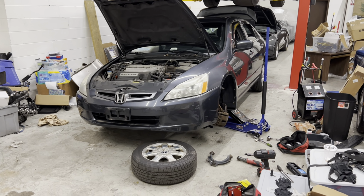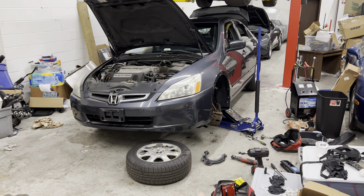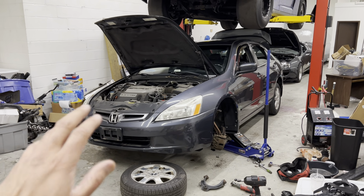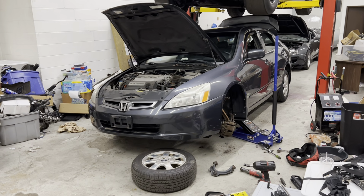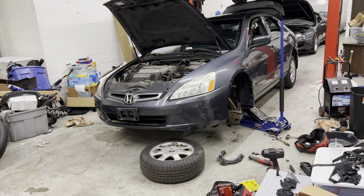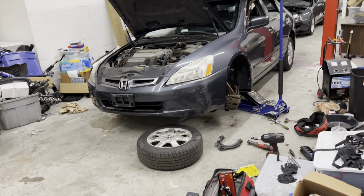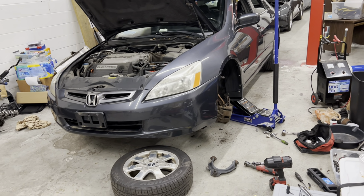How's it going, everyone? In this video, I'm going to be talking about how to check and replace your upper control arm on your mid to late 2000s Honda Accord or Acura TL or any similar type of Honda. These control arms commonly go bad. You should probably check them every month as a preventive maintenance thing because it's a safety issue. If you hear some clunking while driving or if they have any play, you should replace them.